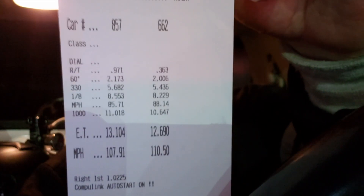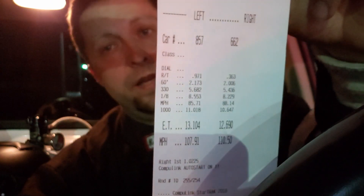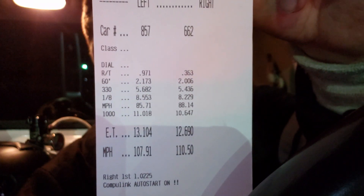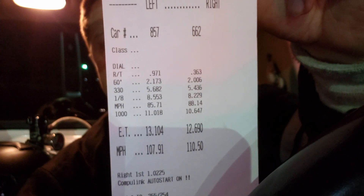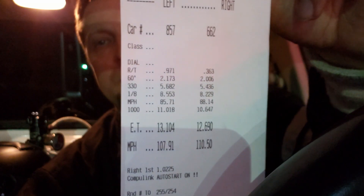All right, there's the slip, guys — there's the pass. We're in the right lane like always, and that's not too bad. That's launching off the motor on the stock converter and then hitting nitrous, a 125 shot, pretty soon. If we can get that 60 foot down like we were on the 75 shot launch and then spray like a 100 shot later, I'm sure we'll see really deep 12s, guys. Really, really deep 12s — maybe an 11.